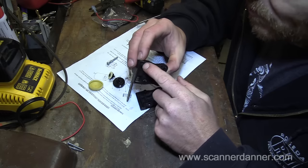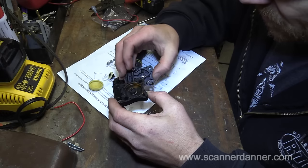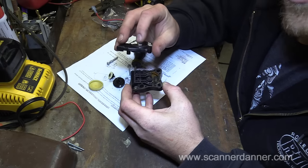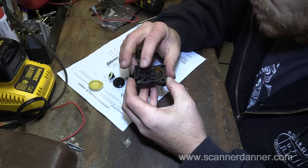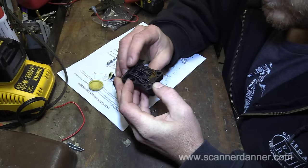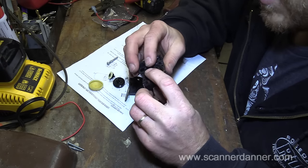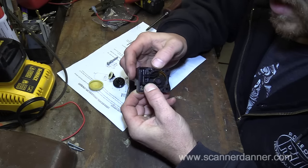So this is your switch assembly. Here's your switch right there. This is just like a hinge point. So that sits like that. Your adjustment screw right here, what you're setting is the tension of this piece, and this is the piece that's going to push upward. So when pressure underneath pushes on this, it lifts this mechanism inside. There's a hinge there. And of course, with this bolted together, this piece would stay intact.